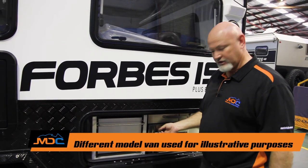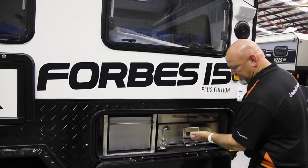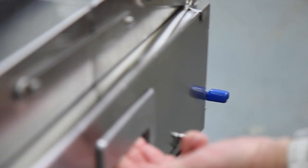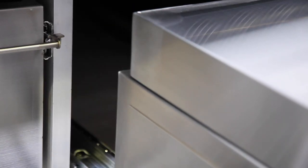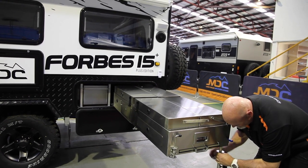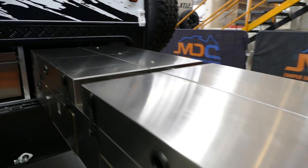As you open up the kitchen, you've got a secondary locking pin — pull it up, turn it on the side, make sure it locks back into place. Blue tab down, handle above. Do not grab the handle below because you'll break the little mechanism there for your extra drawer. As you're pulling out, let the blue handle go, pull it out, and once you're out make sure it has locked into place. Grab your leg — it goes in here as a support leg. Put it in there, lift it up ever so slightly so it takes pressure, and do it up so it can stand on its own.